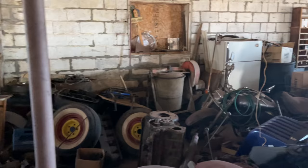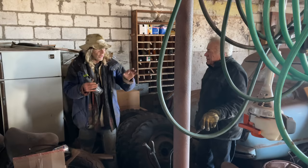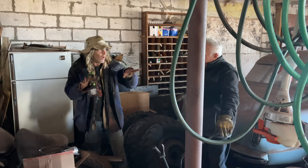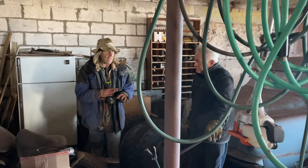The biggest problem with the Hudson motors was, if a little lock washer or one of those retainers cracked and a little chunk came out, it would go down, the dipper would catch it, go up and plug off the hole. Or sludge or dirt in the oil, anywhere near that plunger or that dipper, it would go up, run down the trough, and plug up the hole. So it was recommended every few thousand miles to take the oil pans down and clean them up.